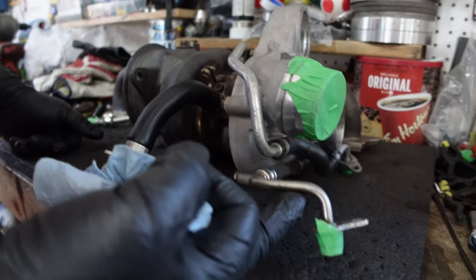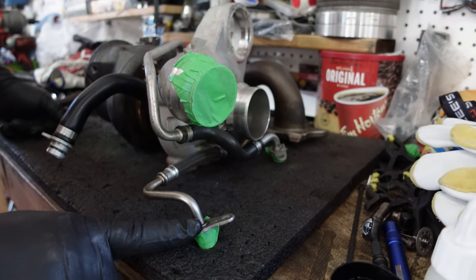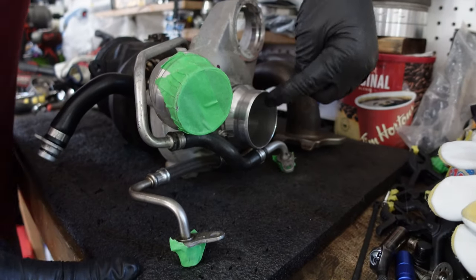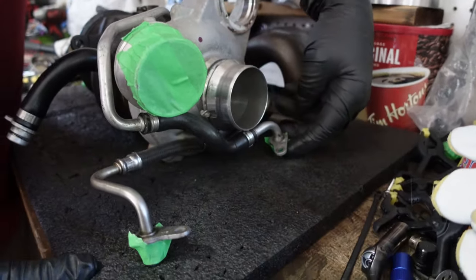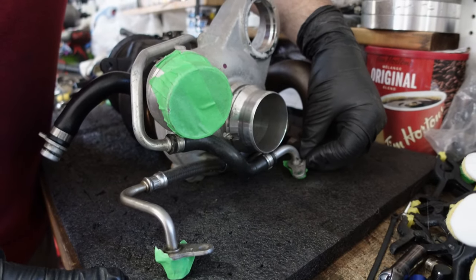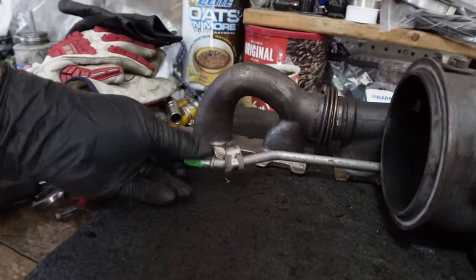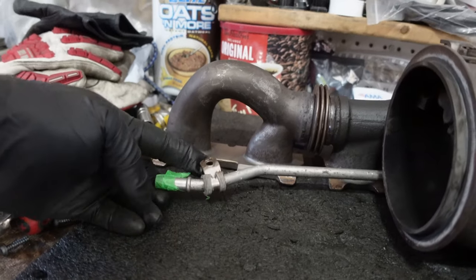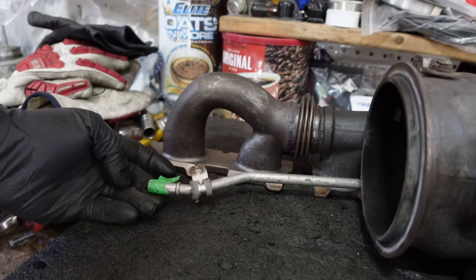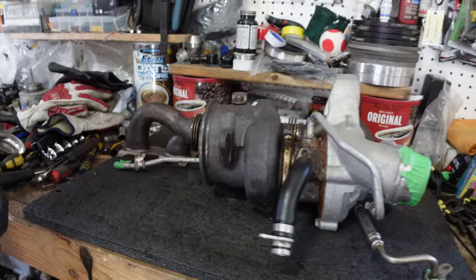You don't wanna leak. This looks like the oil feed. So this one here, again, looks like it's gonna be on the front portion of the block, just underneath where the outlet is. The coolant one over here, you can see it wraps around the front inlet. This is gonna be on the upper coolant jacket or up on the cylinder head. And the rear one here looks like it's going to a soft line. So for this one, there's gonna be a bracket because this is rigid, and then the soft line, which is likely hose clamp. And that's pretty much it. So we're gonna get started.